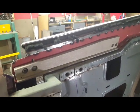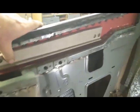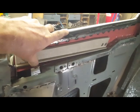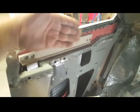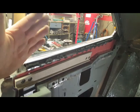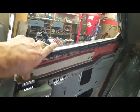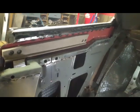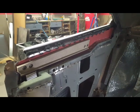This is what the cradle looks like in its spot, ready for the glass. It has adjustment up and down — I've got nylon locking nuts on the back side to lock it in position. It can also tilt a little bit. If it ends up being out one way or another I can shim the glass itself or shim the bracket depending on which way it needs to go. I don't want to get too elaborate — this is elaborate enough for a stationary window.